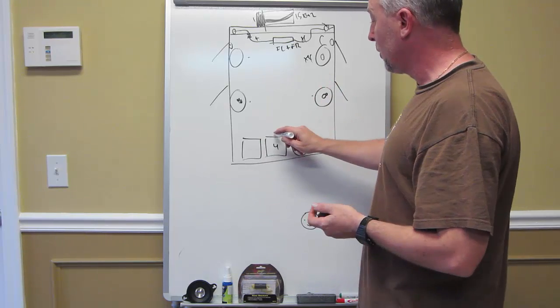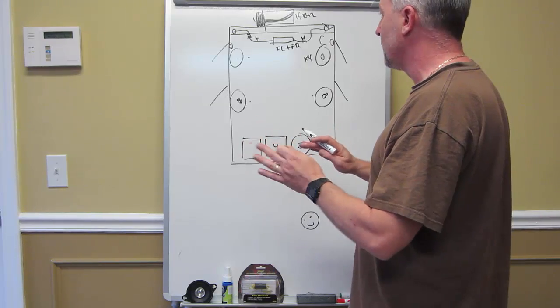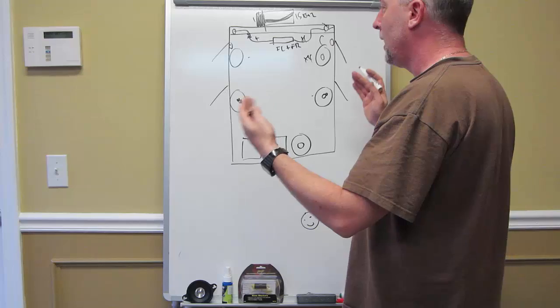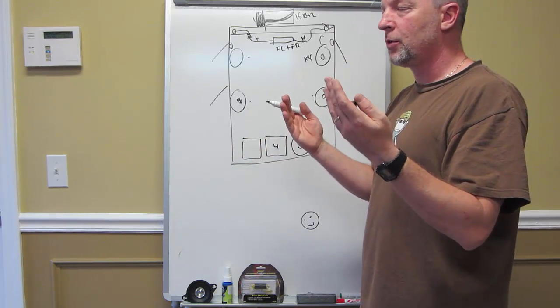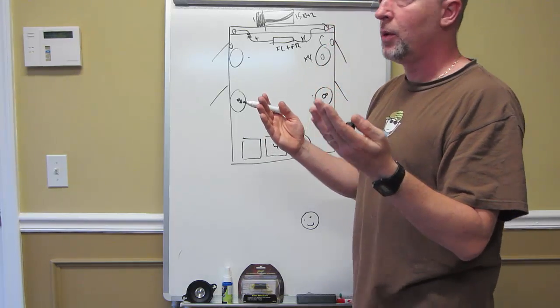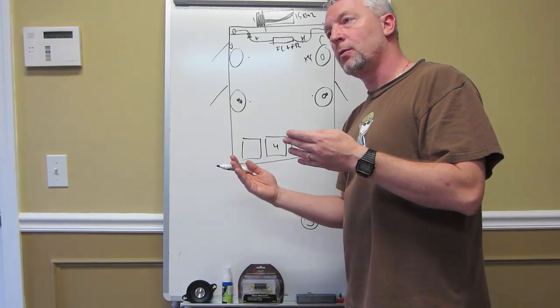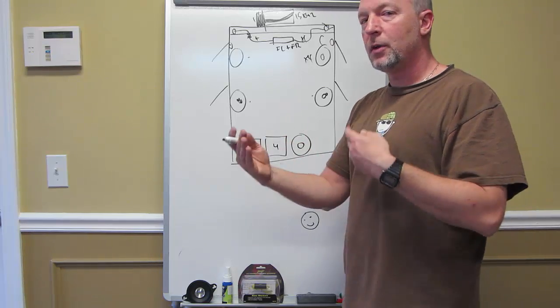That's where you have to go into adjusting the gains on your amplifiers a little bit, tweaking it, making everything sound nice. Especially when your vehicle is big, it's wide, you want to kind of get everything to sound right. My trick is to sit in your driver's seat, close your eyes, and move your head to the right and to the left. If everything sounds equal while you're moving your head around, you've got it right. If you can hear too much when you go right, and it gets too low when you go left, you know you need to adjust.